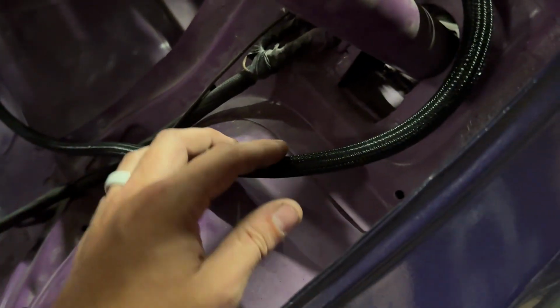Of course, I didn't think about the fact that since I bought more line, I would also need more sleeving. So I didn't have enough sleeving, but I just used some of the wire split sleeving that I have for the 2 rear lines in the interior. The ones in the interior don't really need heat proofing. They don't see a lot of heat, especially in the back seat. It's more the engine bay where that's a concern, but at least this sleeving on here will protect the lines from rubbing on anything and potentially getting damaged. So like I said, we'll just throw some zip ties on some of the lines, and then it's all good.